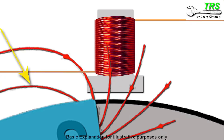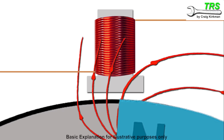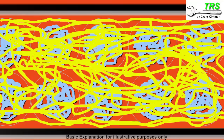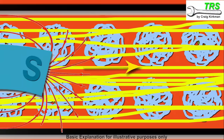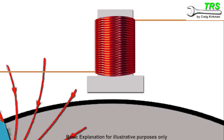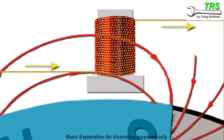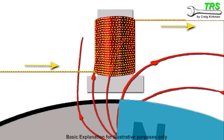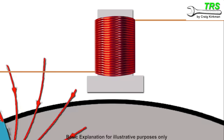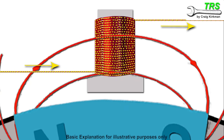When the magnetic field on the flywheel's fixed magnet passes over the trigger coil inside the coil pack, the electrons inside the copper wire react to the magnetic field in such a way that it pushes them all in one direction — they're no longer moving randomly, they're all uniformly moving together. So as the engine turns and the magnet passes and passes, it moves those electrons forward inside the coil. Because all electrons are negative in charge, they're all repelling each other, so as some electrons are pushed forward they repel the electrons in front of them — a bit like the flow of a river pushing water downstream. This flowing movement of electrons is what we refer to as an electrical current.